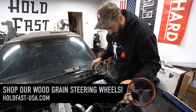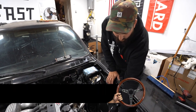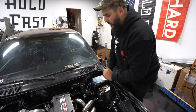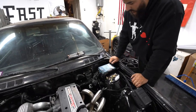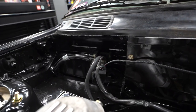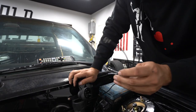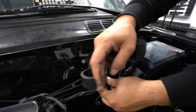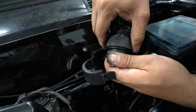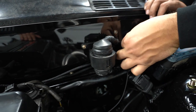I just gotta tighten it down and you're good to go. So now that the fuse box is mounted, I'll eventually cut these studs down — maybe not, who knows. Again, you gotta have your plug sides going toward your ECU, and then the other sides you gotta get running toward your battery power, toward your engine, and then toward this plug here — which I still haven't figured out what it's called. So now this wire, a power wire, is gonna come over here and plug in. Ground wire is gonna go to your valve cover or the back of your motor somewhere. And then there's another ground wire here that we can plug in. The harness directly to the BMW setup, just like such. Screw it in, make sure that's good. And voila — now your AK harness is plugged in.